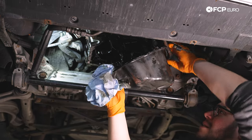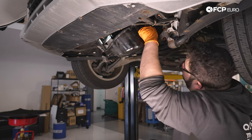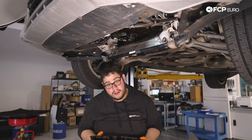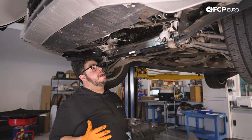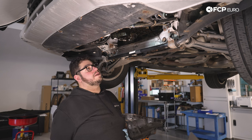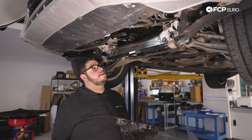We're going to kind of come out towards the driver's side over here — that's why we have a catch pan situated. Don't forget there is a little rubber grommet going into the oil pan that holds a wire in place — we missed that one, so we're going to pop that free real quick. The key thing to take away: the pan is going to come out towards the driver's side. What I highly recommend is after you clean up your surfaces, practice putting on the pan without any silicone so you can get a good feel for how it's going to go back in. The last thing you want to do is smudge up all the silicone and give yourself a leak when you install everything together.